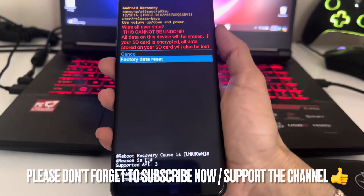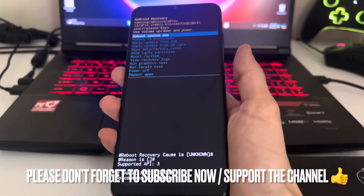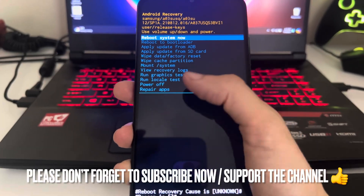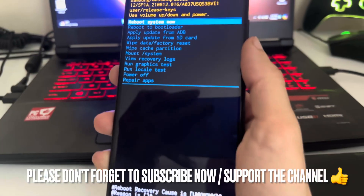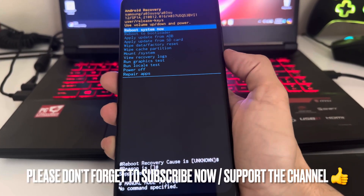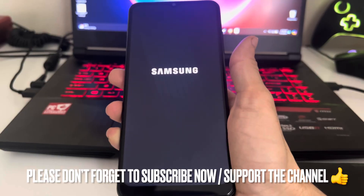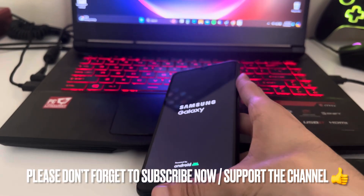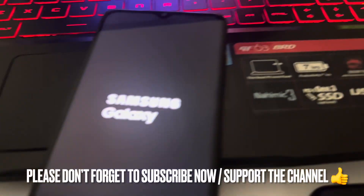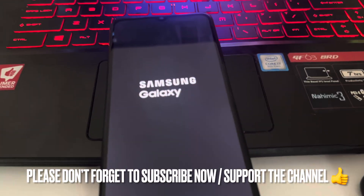I did that before, so I don't want to do that again. I'm going to go up and click cancel, then click the power button to select cancel. After you do the factory reset — which is going to take you less than a minute — go back to the list and click reboot system now. Sometimes if the method didn't work, make sure you go back and click wipe cache partition. Now I'm going to reboot the system to reboot the Android phone. Once you reboot your phone, just select the first choices like the language and settings. After that, you're going to be able to use your phone without any problem.